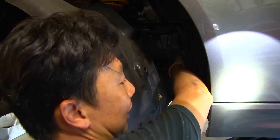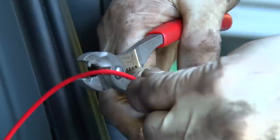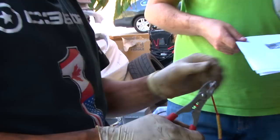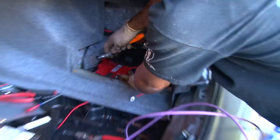We need to tap into the EDC wiring on that side plus the battery. This is Rob's 'Jack Bauer moment' — he's got to cut the right wire. We crimp on a connector for the computer that controls the KW shocks, then connect the positive wire to the positive battery terminal. The other end connects to the wire from the DDC controller, and we join them together with a 10-amp fuse.